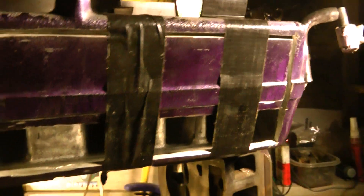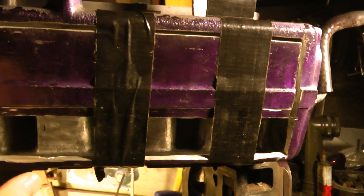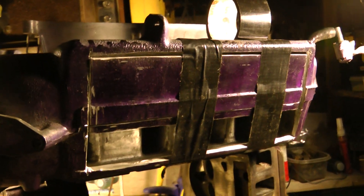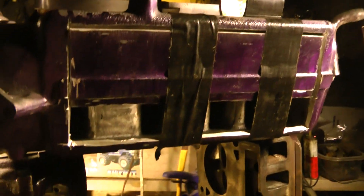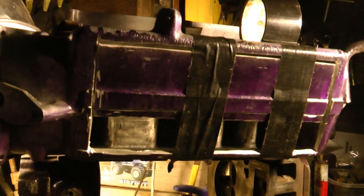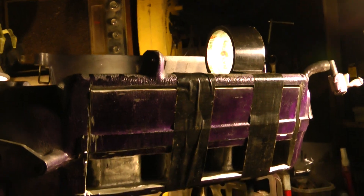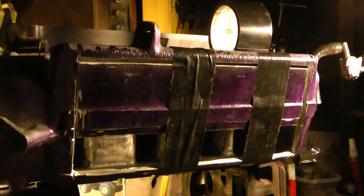I was experimenting with a couple of ideas. I was originally thinking of doing this, then taking the welder. The thing is, I'm not running a legit aluminum welder — I'm just running it through my 120 flux core. I've seen other people do it; you just put a big 40 thousandths inch nozzle on it. You can run flux core with no gas, so it won't be structurally as strong as it could be, but this is going to be a combination of epoxy and aluminum weld.